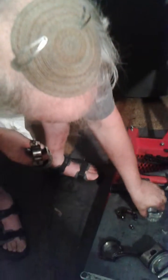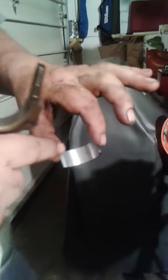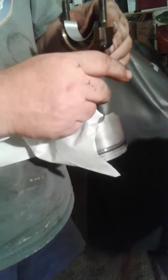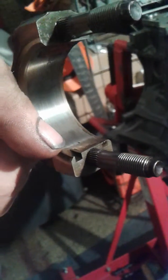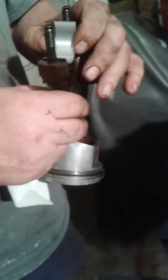New bearing shells. These happen to be the same kind of bearing shell top and bottom of the bearing surface on these pistons. They only go in one way — they've got a little notch that goes in the little notch. Real simple. So you've cleaned any junk out of there. Do not touch the bearing surface — the oils, greases, and acids on your fingers will start to etch it. Show the groove a little bit better. There's that groove — it's very small. It locates the bearing. So don't touch the surface of the bearing material.